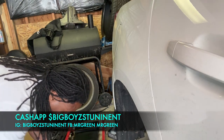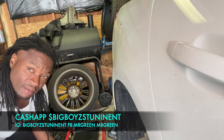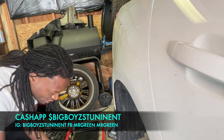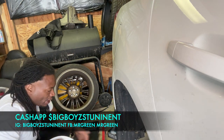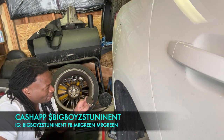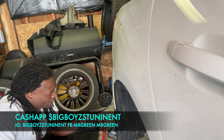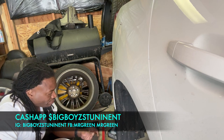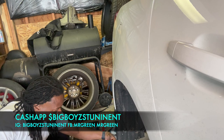So the old rotors — and I'm going to tell people how they know their rotors are old. Because your rotors make noises, they hum, they roar when you start rolling a car to get to certain miles per hour and start making that noise. That's when you know you need rotors. And I advise a lot of people that's got that problem now: just change your rotors and possibly change your brake pads. But I really didn't have to change my brake pads because I just changed these about a month ago, and they did pretty good. They didn't tear them up.